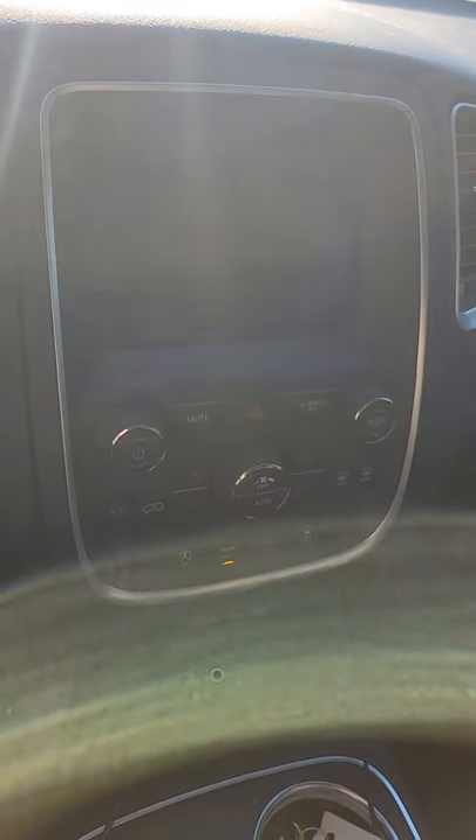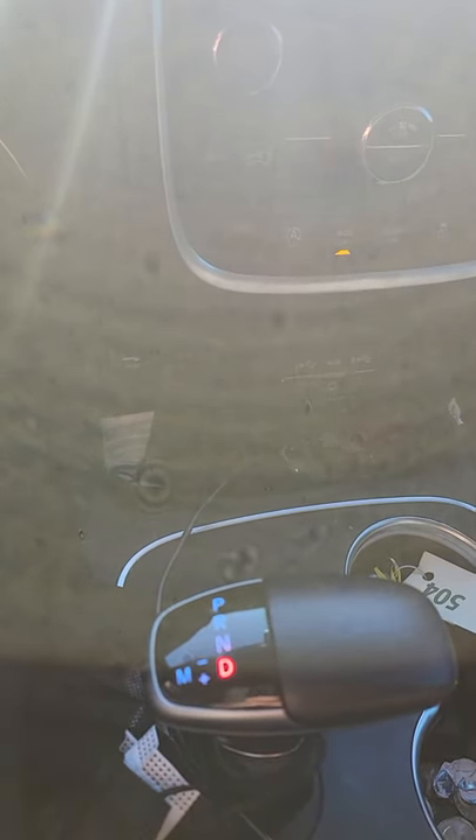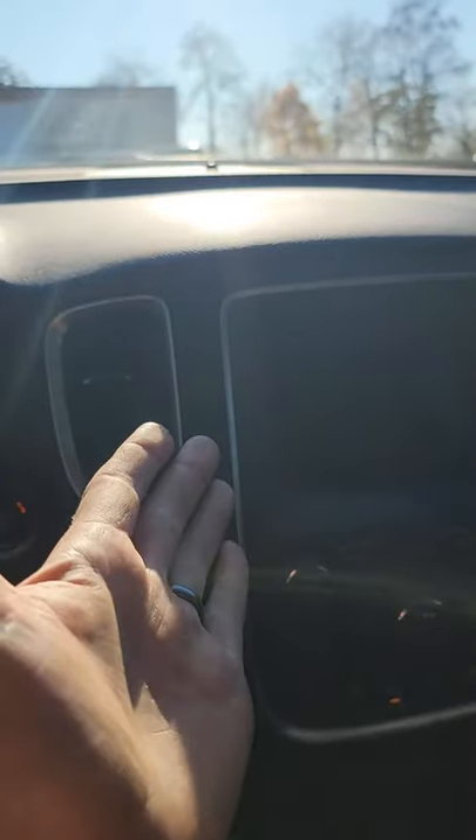Let's go to a higher incline where you can see a much more violent jump. So right now I'm on a much higher incline. I'm going to go to park and let it roll back, then go into drive. There's a harder clunk because there's much more tension on that gear on the tail housing, and the park pawl is releasing so the gear finally gets a chance to move. If you don't want it to happen on a hill, firmly apply the brake, apply the parking brake while in drive, go to park, and the vehicle should slightly move — not that back and forth movement — and this should relieve that clunk.